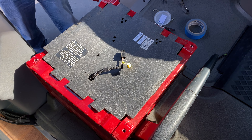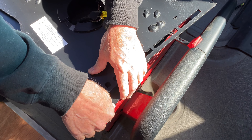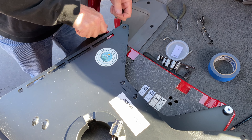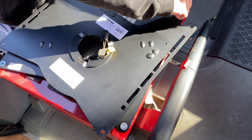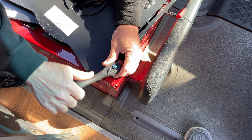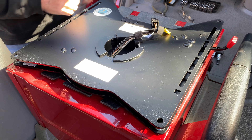We're going to bring the seat swivel in and put the orange handle toward the parking brake, and align it with the holes in the pedestal. Swivel the pedestal a little bit so you can gain access to the mounting holes, and then use the supplied hardware to bolt the seat swivel in place. Using a number six Allen head, tighten down the bolts. What I like about this already is that when it's locked in place there is no slop — it is nice and solid.